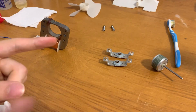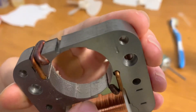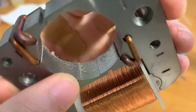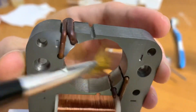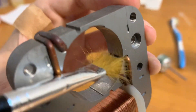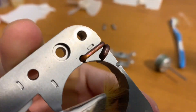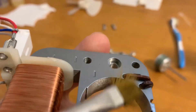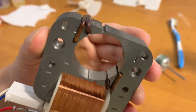It's also a good idea to check the inside of the stator where the rotor sits, to make sure there's no dust. You can see some light fluff in there — clean it out. Sometimes there'll be some dust stuck in the little grooves where the shaded pole is — that short winding.